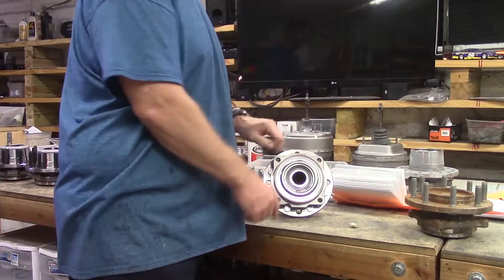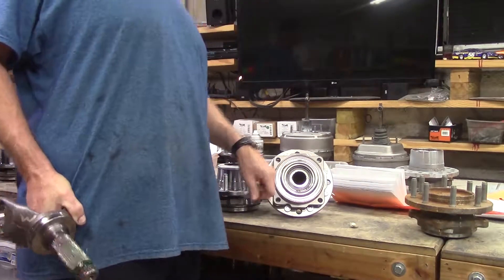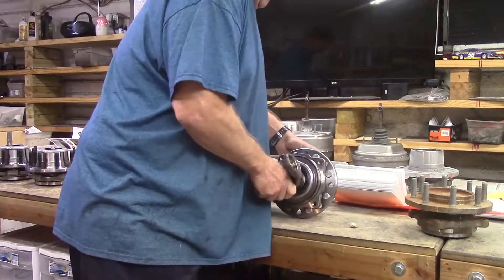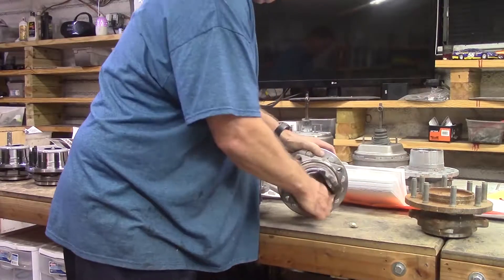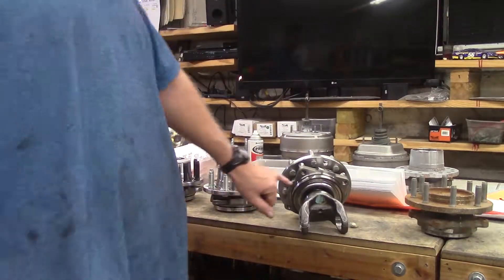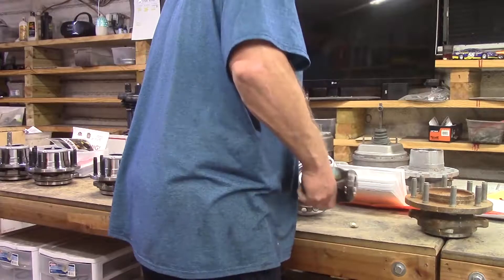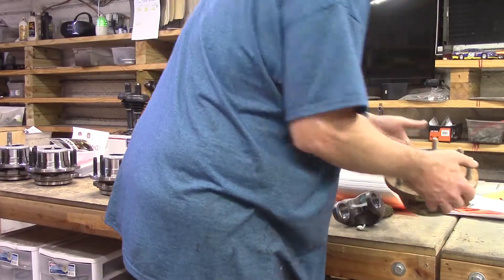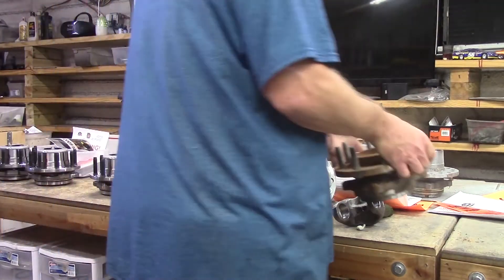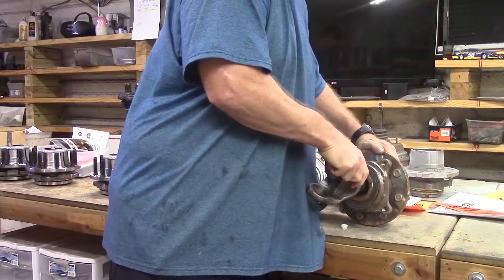And then in the back here we've got our spline thrust bushing. The whole secret to these is that these thrust bushings and these locker gears are in our spline. That is why you don't have to change the stub shafts on the 2009 and up. On the 2009 and up, you don't even change the stub shafts — these are one-piece assemblies. You literally unbolt your old ugly spline hub, your full-time four-wheel drive. There's your hub and there's your stub shaft, and it goes in those splines.